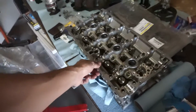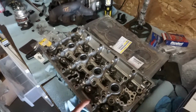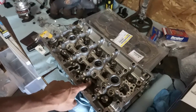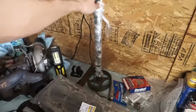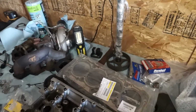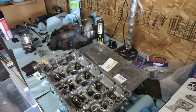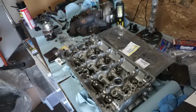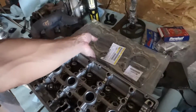And here's my head, basically a GSE head. So stock valves, GSE seals, GSE beehives, and to go along with those beehives, I have the GSE S1 cams. Those hit my target goals. This car originally was hitting 410 horsepower and I loved it, and I think at max maybe I'll hit 450. I don't plan on going any more than that because then other stuff starts breaking.